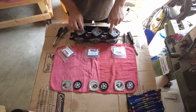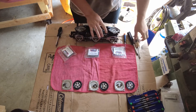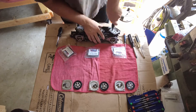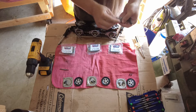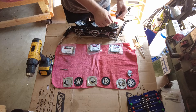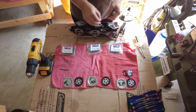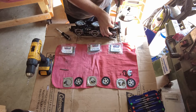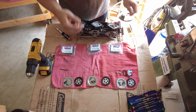Now I'm going to move on. First, I'm going to take this cover off. Again, be very careful not to strip anything. If you don't have one of these, I highly suggest it - it's really hard to strip a screw out with this. There's the gasket out of this side, 107. There's the needle - it doesn't look too bad, but I think we'll go ahead and replace it anyway.